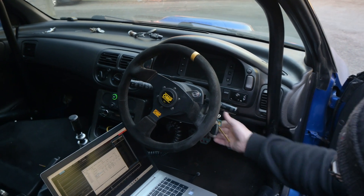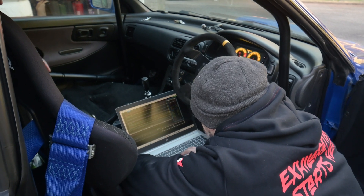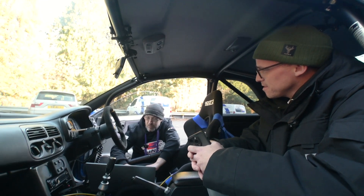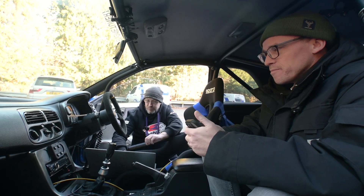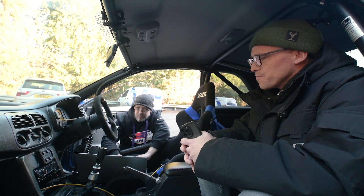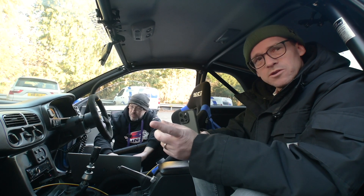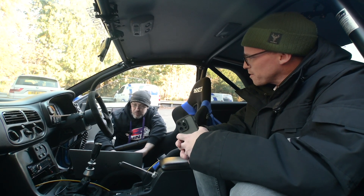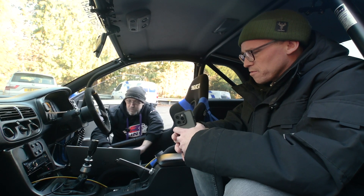It's not great TV this, I'll tell you that. The manifold pressure reading has suddenly jumped to 3 bar and stuck there, which is why the engine cut out. The MAP sensor, Martin thinks, is faulty. But it's almost a brand new thing — we fitted it when we put the bigger turbo on with the old engine because we needed a 3 or 4 bar MAP sensor. But it's getting some funny reading so we've got to replace it.